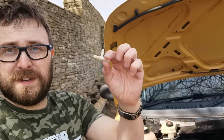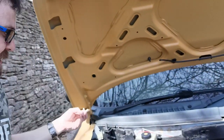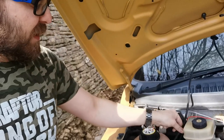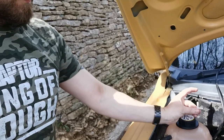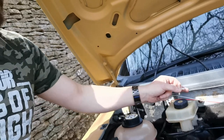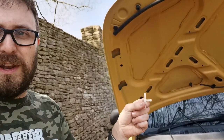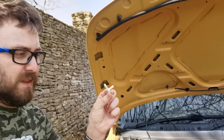Okay, so with the fitting, we're just going to take this bit — it's a little T-piece. This was the one installed here for the first washer jet, and you then had the sort of 90-degree that went up in here and then ran it along. So this is all going to come out. We're going to snip this pipe down here, tucked away. The T-piece is going to go into the original black pipe, my new pipe is going to come off the top of it and out of the right side of it. One bit's going to come straight to this wiper, and the T-piece will allow one more bit to run along the bulkhead and then straight up here — so we should only need one joiner for all of this. Just this one little T-piece is going to allow us to go all the way around to all the other bits.